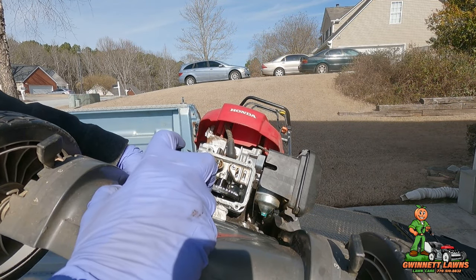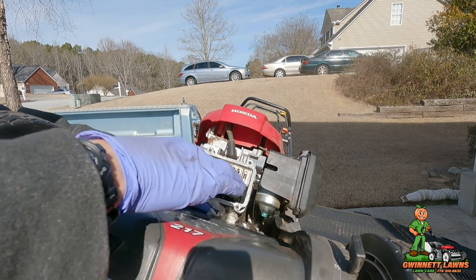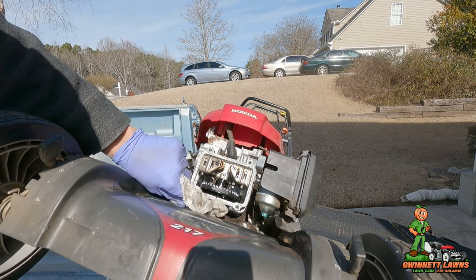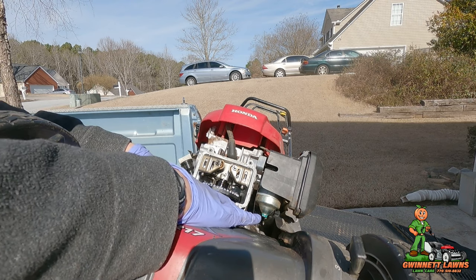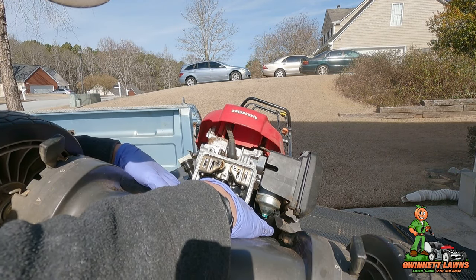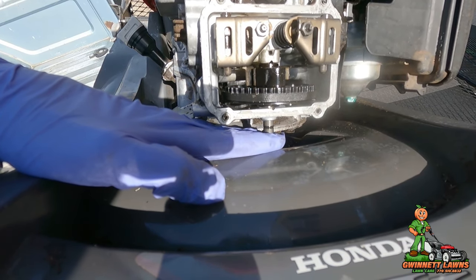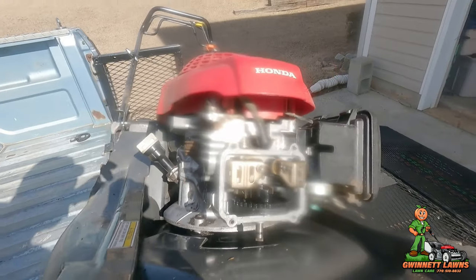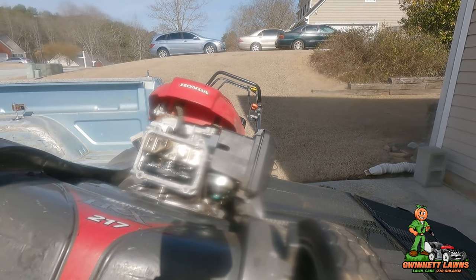I'm going to clean off the area right here where we're getting ready to pull out our pin that keeps the camshaft gear in place. There's not much pressure on this pin. I'm thinking if I pull it out very slowly I don't want the cam gear to move. I can see the o-ring — it's right there on the end of the cam gear. That little o-ring is hard as a rock, so that's definitely where some of the oil leak was coming from. I'm going to turn the camera off, replace that o-ring, and be right back.